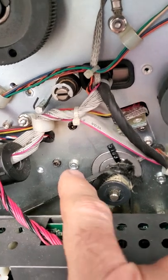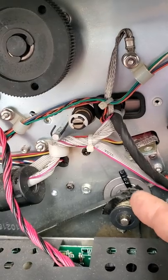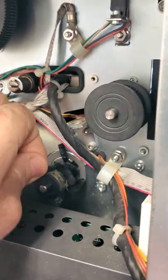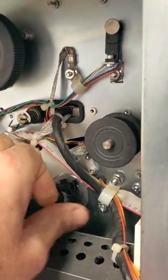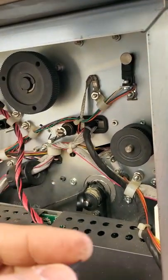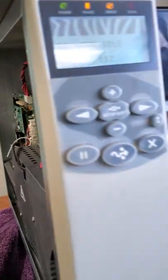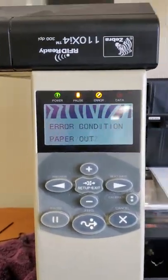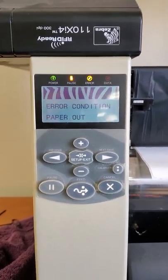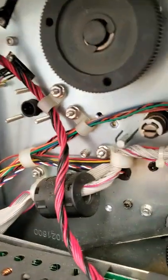In this case they also have the rewinder option, so that's what the secondary belt is. Because it has that option it has a double sprocket here, and you can see the remnants of the belt on this printer — the main drive belt is completely destroyed and wrapped around. You can get label out errors for a number of different reasons, but if you've blown out your main drive belt you can get that error, especially if you get a label jam that completely locks the printer up.